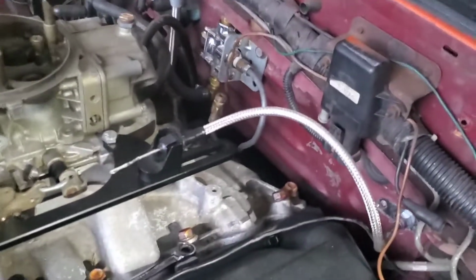It was about $27. So, what I did was pull out the plastic piece that the cable pulled through, put some JB Weld down in there, and ran the cable through, but first I put in a washer small enough to hold and catch the lead ball at the end. I let that set up, pushed the cable through, cleaned the cable off, and I have everything run back together now. So this is where we're at right now.